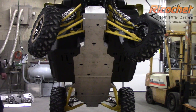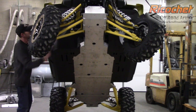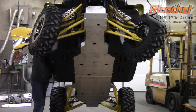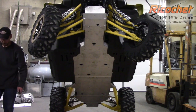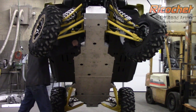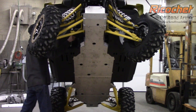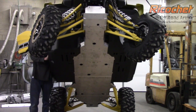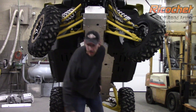And then there's also a mount inside the footwell that I've also pulled out, so I'm going to reinstall that as well now. And then we can go ahead and tighten all three of those down, if I can find my ratchet. There it is. So there's one here, second one here, third one here, and then there's the one that's accessible through the passenger footwell. And on the driver's side, you don't really need to remove that one.